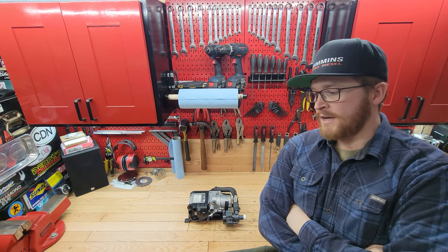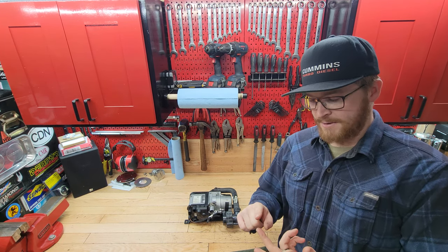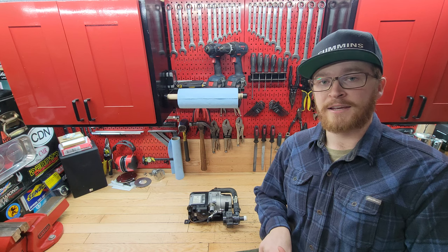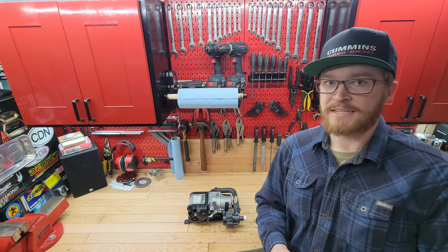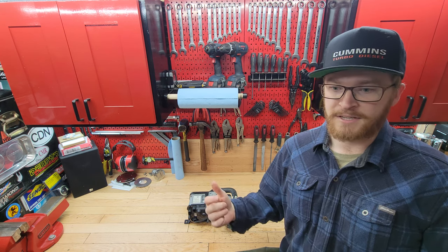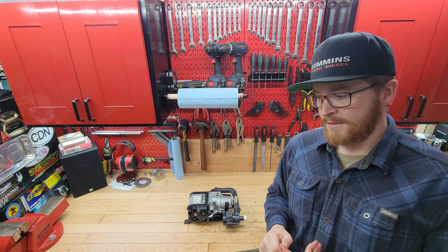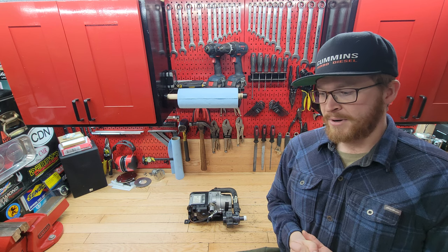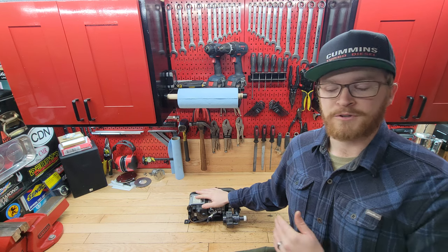This is a bit of a big install — it requires a few different things. In the kit I have a control unit to mount in the cab, the Webasto itself to mount in the engine bay, and I have to run a fuel line back to the fuel tank. I'm thinking I'll have to drop the fuel tank to plumb it properly. Then I have to route the intake and exhaust tubes, and run the wiring harnesses back to each component including the fuel pump near the tank and the control unit in the cab. First things first, I'm going to decide a location to install this in the engine bay.